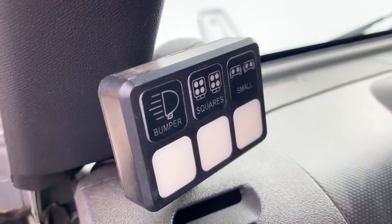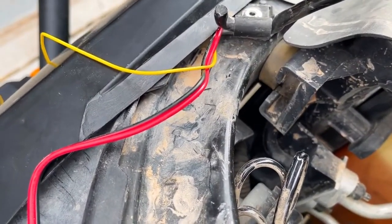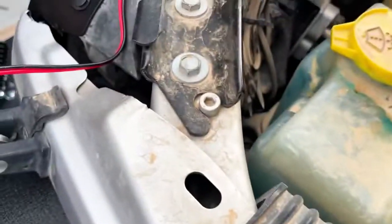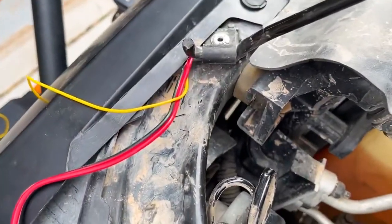I'm going to put a link down below on where you can get this switch. The three wires coming out of the grill are black, red, and yellow. The black goes to ground, which attaches right to this post on the body. The red goes to power, which is right here on the switch panel, and the yellow is going to be wired to the daytime running lights.